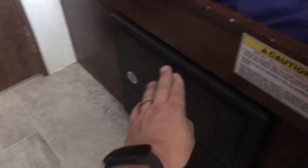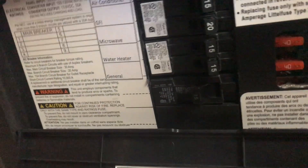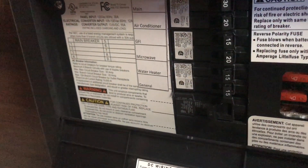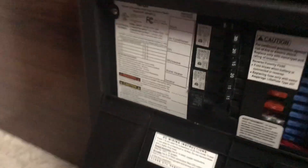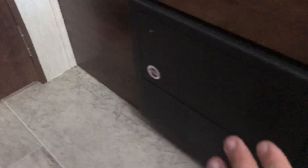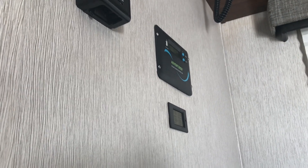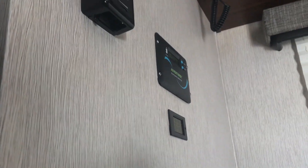This is the actual power converter system. One of the things I covered before is that I added an extra breaker to the system. You can see that last breaker is in the off position — while we're sitting here in the driveway I have everything else turned on, but that last breaker is off because that's the power pack down below. I moved the line for the power pack onto that other breaker, so that way I can effectively boondock while it's sitting in the driveway, because the power from the solar charge controller with pulse-width modulation is actually better for the batteries than it is from the power pack.